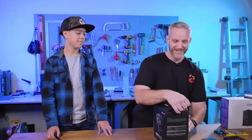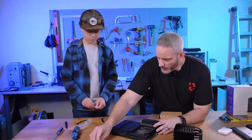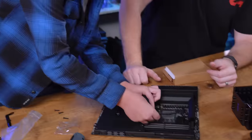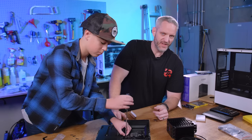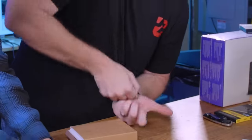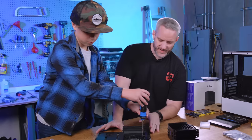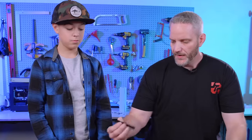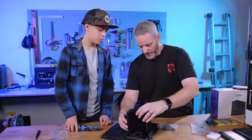The first thing we need to do is get these screws ready. Be careful when you open them - they like to roll because they're little nylon standoffs. I like how he's not scared; he just gets right in there. So the bracket teeth will bite into the heat sink and rest down on it once we put the thermal paste. Pull that plastic piece off - satisfying! Now you're going to squeeze the thermal paste right on that, make it like a big circle. All right, that's plenty. Set it down in the middle and line those holes up with those holes there. Perfect.